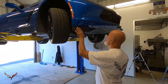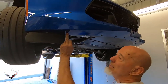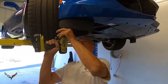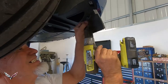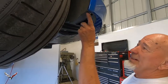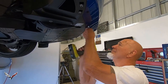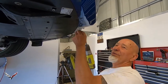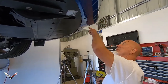We're going to start by taking these off — both sides — and all these screws right here. That'll be disassembling this part so we can put the other one back on. These are all 7mm screws. The ones on the end are shorter — remember that — and these here are a little bit longer. Nothing will fall off when you take these out because it's secured in other places.